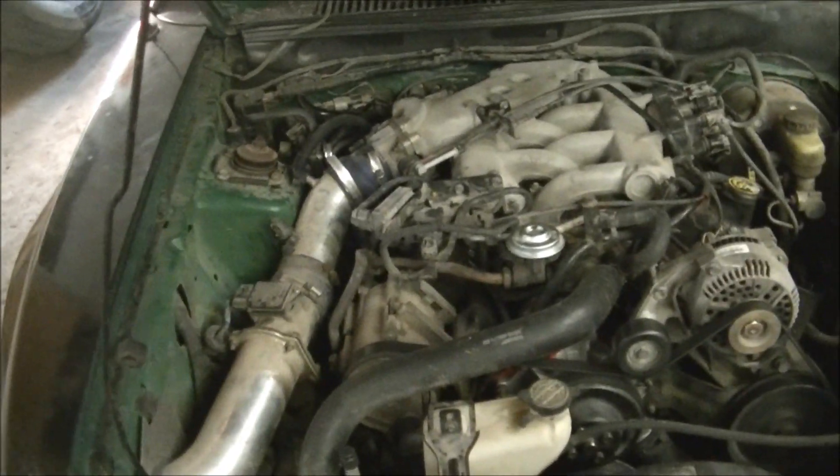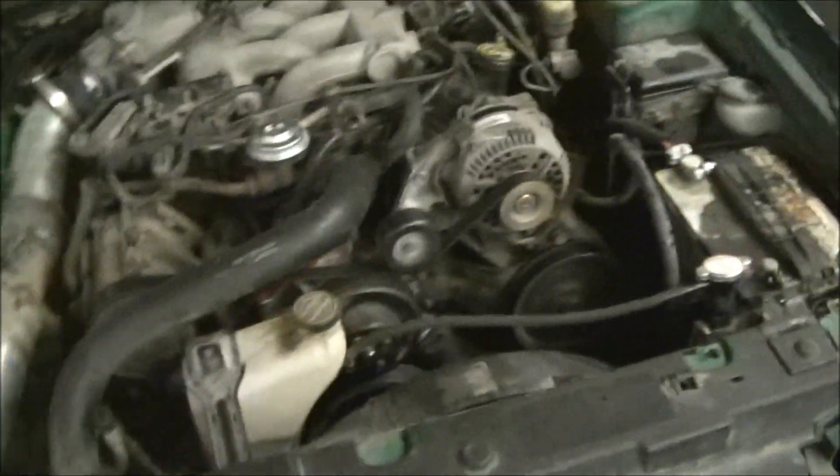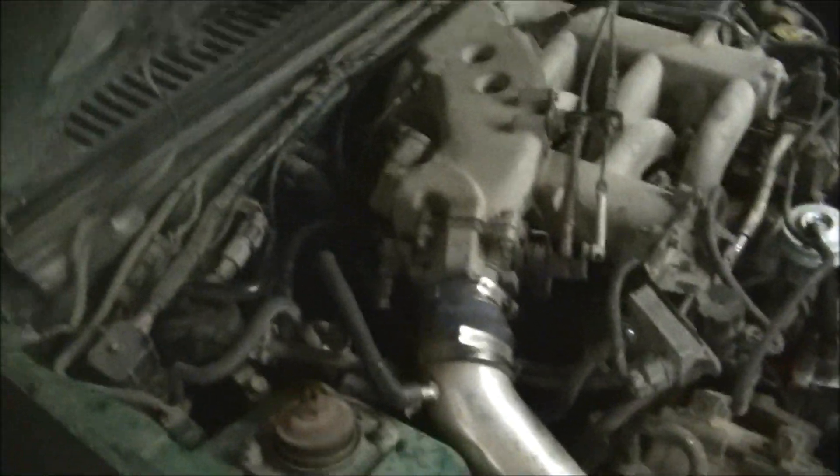It's supposed to be nice today, so we're going to drag the garden hose out, hold the heater hoses off, and try to back flush it. If I can get her a little heat, that's better than no heat, because there's absolutely no heat on it now. A way you can tell if the heater core is blocked — bring it up to temperature, grab the heater hoses: one's hot and the other one's ice cold. So there's no water going through it at all.